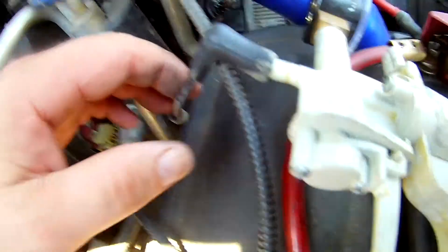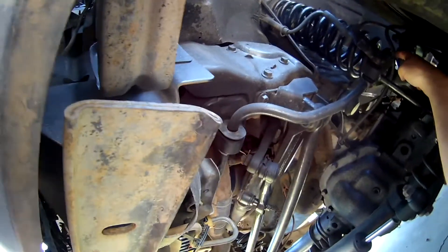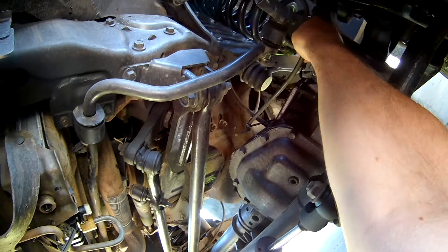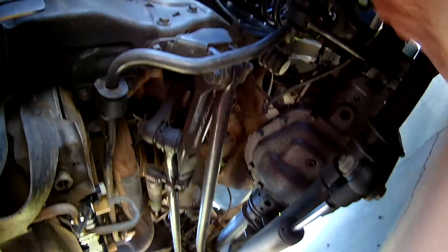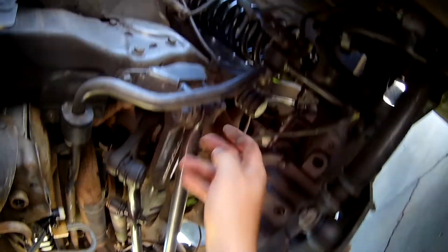Alright guys, I'm back underneath the truck. I have my kid — he wants to help me out. Okay, so this line here... some of these hoses are kind of cracked and pretty old looking. I'm going to hook my vacuum pump up there and check the hub. I'm going to hook it to both sides and see what's up. First I'll check the locking hubs down here to make sure those aren't leaking.